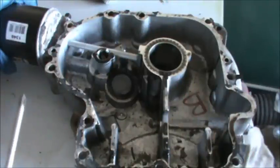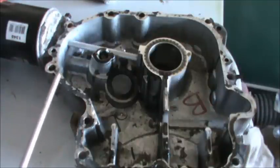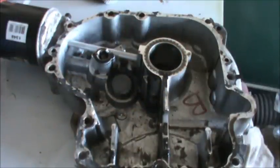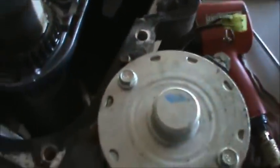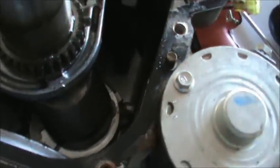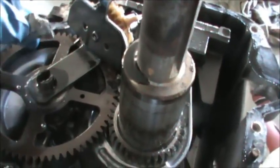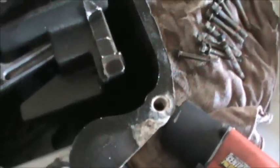Here's a look at the sump — you can see it has an oil filter, which is the better model. Some of the 17 and a half models don't have the oil filter. If we look in here you can see there are little bits of aluminum, so we're going to have to investigate further. Now looking into the block — the crankshaft looks good, the connecting rod is connected to the crankshaft journal and that's not broken. On the cam we can see a little more aluminum, and all the way down in the block there are more pieces. I think this aluminum is from the piston skirt.